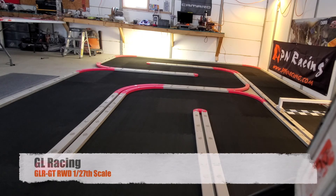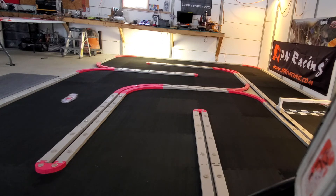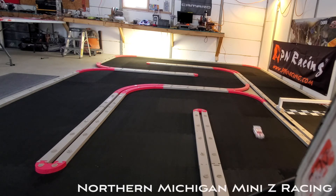These are the first runs with my GLR GT. I've been having a hell of a time getting it to turn, so I put on some aluminum steering knuckles in the front — that made a huge difference. I messed around with the ESC so it's not so powerful, and I added some steel weight to the front. There's a little adhesive steel tire balancing weight, and she has come around.